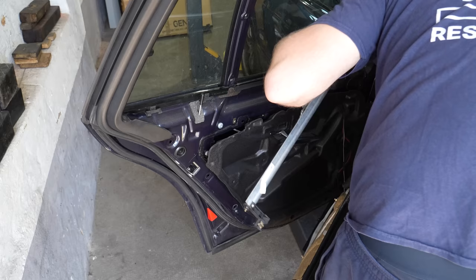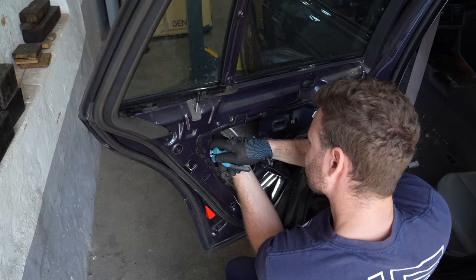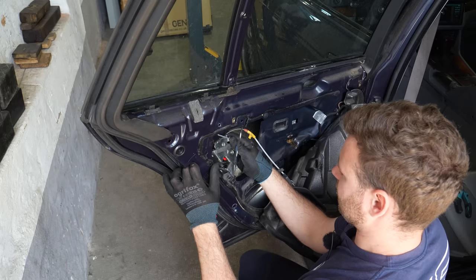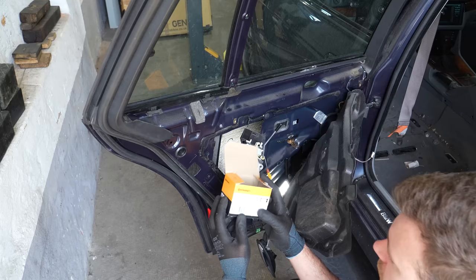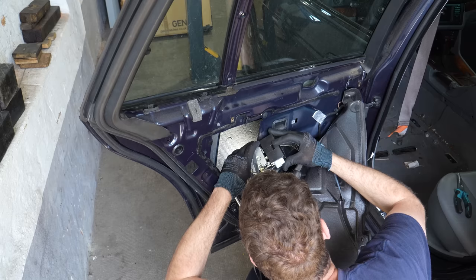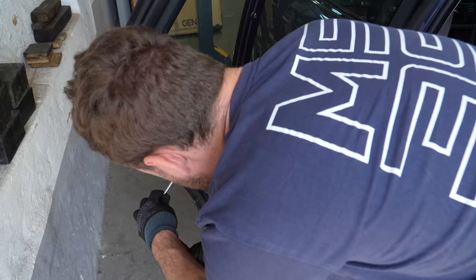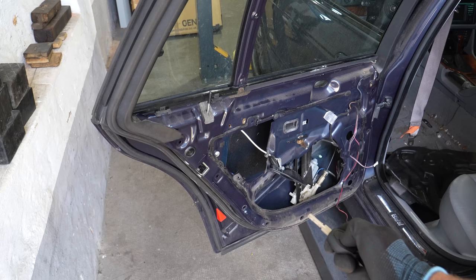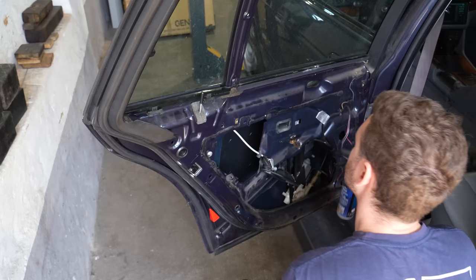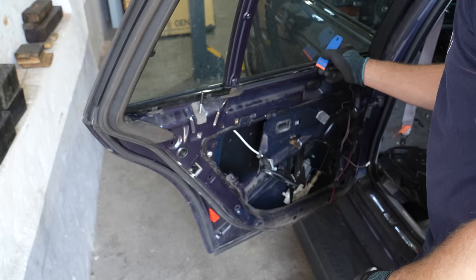That's how that goes — that's the broken shade. Good, that's the door panel off. As you can see someone was already in here. The easiest approach is to simply unbolt the lock. There we go — that's the door actuator out. Here's the new OE one from Continental/VDO. Make sure to engage this tab here with this lock otherwise it won't work properly. Make sure everything is clipped in properly and turn the plug. Clip in the door handle — working as it should. Now clean all of this up and put back the vapor barrier. There's glue residue here — liquid Moly orange cleaner hopefully can get it out. That thankfully cleaned up.